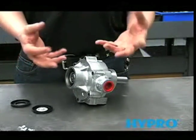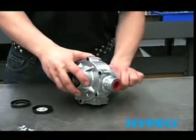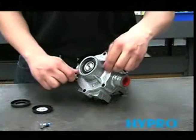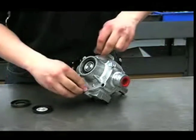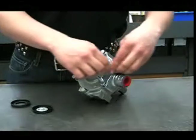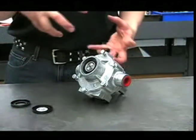If it turns freely, now we can put the bolts back in. Start them by hand so you can make sure that they're all lined up. When you tighten them down, go in a criss-cross pattern instead of in a circle, so it draws together evenly.